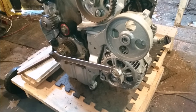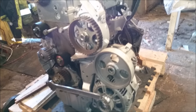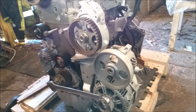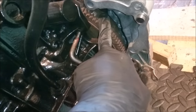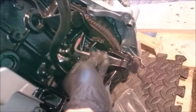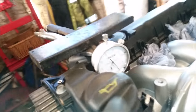I'm not 100% sure where I left off, but I think it was on the gearbox over there, which is now in place. I made a bit of a boo-boo with my knowledge. So, the XU flywheel - which is actually a GTI6 flywheel - we need this flywheel because it has the right teeth for the flywheel sensor for the HDI, and it will take an XUD pull-type clutch which will hold more torque, and I've got a paddled clutch, so it allows the amalgamation of those parts. However, they don't have a timing hole in the back like the DW10 HDI XUDs have, which would be useful. So they are timed at the front, which the HDI isn't.